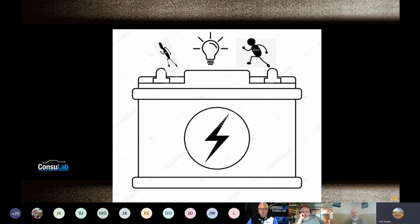Well, let's look at this picture here. I'm leaving the battery, and the wire I'm passing through could be a place to drop voltage. This is not even really a complete circuit here. This is an electron leaving, lighting the bulb, and going back to the battery. We're going to go to the MD in a second and do this, as long as I don't keep talking too long, and see a real simple deal. In that particular circuit, that's the work to be done. There's getting there, doing the work, and getting back. And I'm weaker when I come back because I spent most of my voltage to light that light bulb.